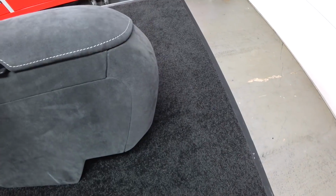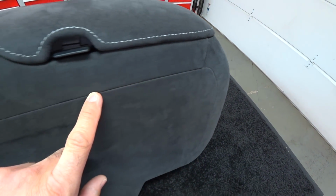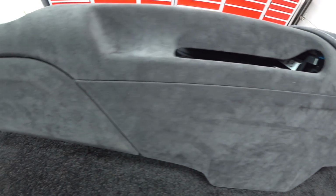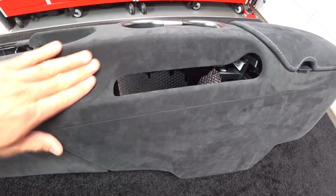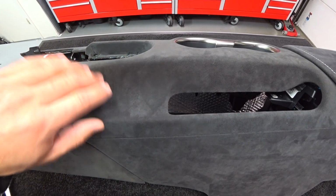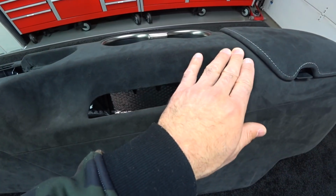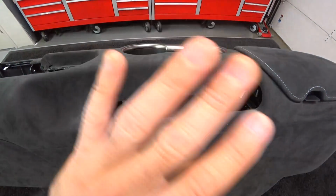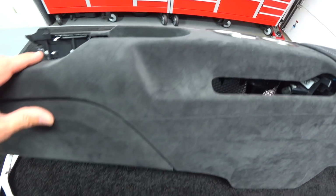And you guys can see the rear wraparound, and you can see the tight tolerances between the panels, and if you don't do the job right, these panels are not going to fit together anymore. The hardest part of doing the top stack is the e-brake section here. It's just an absolute disaster, and wait till I show you guys in the next clip of the video how the material does not lend itself to stretching and going around radiuses. This material is really made for flat panels, with very little undercuts and radiuses like that.